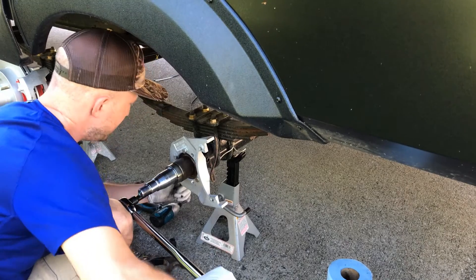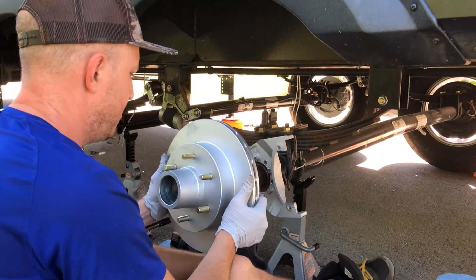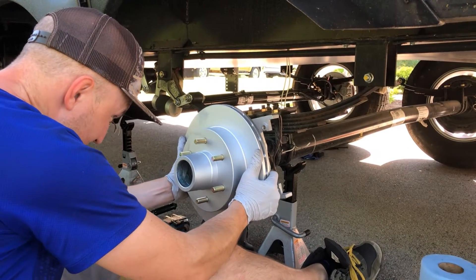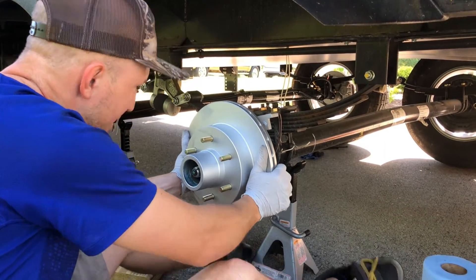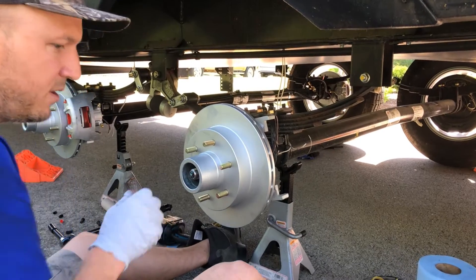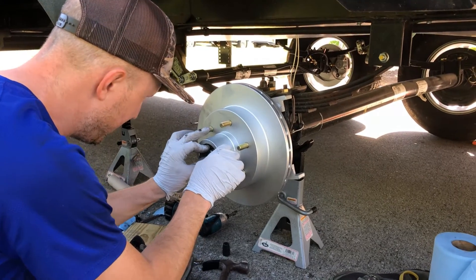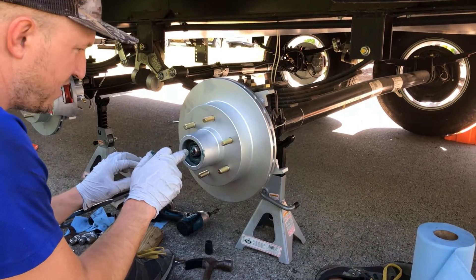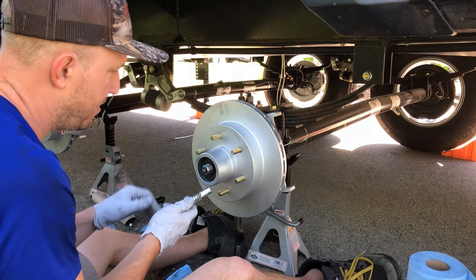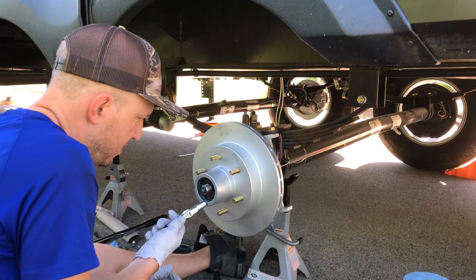This is not the time to ballpark it — if you don't have a click-off torque wrench, for these types of projects you really need to make sure you're getting the correct torque. Here is the rotor where I've already pre-pressed the inner bearing and done an initial fill. Get it seated nicely and then get the outer bearing. The outer bearing gently goes in — I'm not worrying about packing the inner portion because the easy lube zerk will help pack it through.